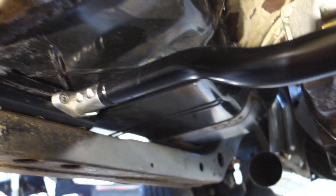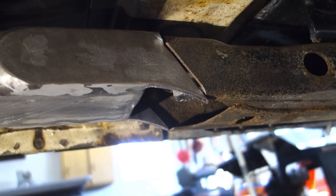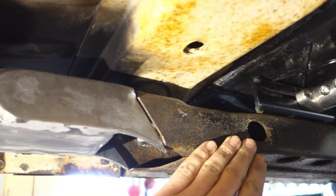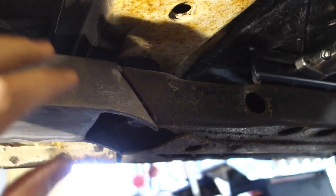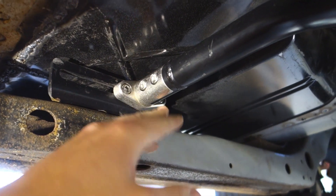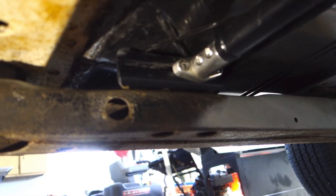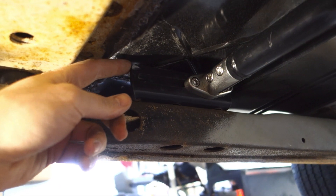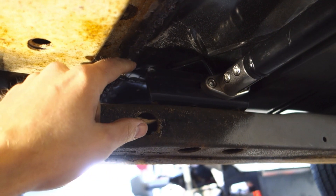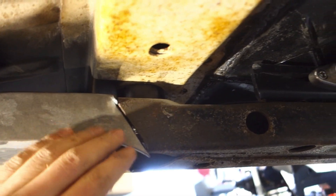That's it — she's back in, jack stands out of the way. I'm planning on welding my subframe to these subframe connectors, so this part's already done. I've got the subframe lined up and I know this is where it's going to be whenever I take it out and put it back in. Then we're going to weld all this. That's where this becomes nice — you can just drop this down without ever having to worry about removing these brackets. One more tip: make sure the bolts you're using to attach these brackets to the subframe can be pulled out with the subframe attached to the car. Only use the length of bolt that's necessary to actually get the nut on — especially if you've got welded subframe connectors, because you're not getting this back out. You'd have to cut those bolts as you lift them up.